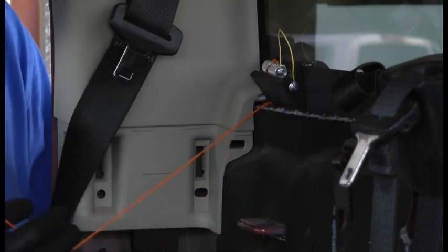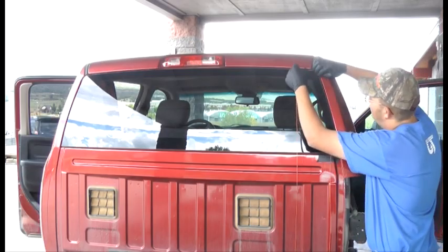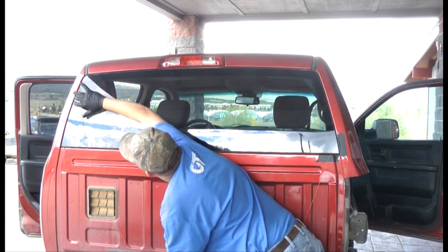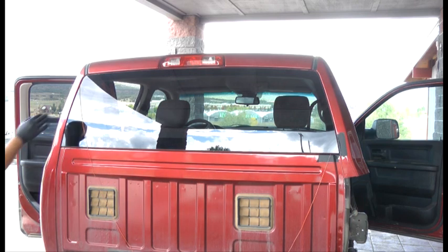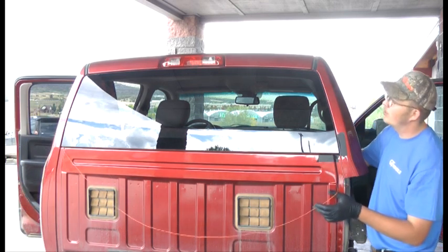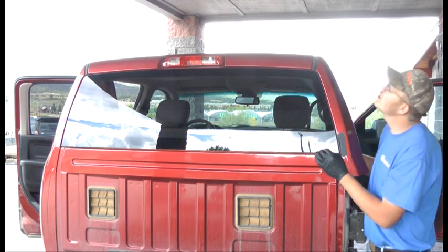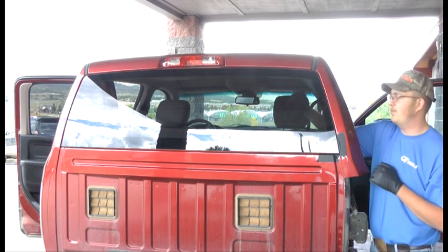We'll go around the outside of the glass and come back to the inside for the shortcut. We're gonna go up around the top first, because the glass will be your friend and hold the string where you want it. So now with this slack left, we'll pull the rest in from the inside, and it's pulling all the way around, but it's pretty easy, don't have a load on it. While you're doing this, you want to make sure your string's staying in the pinch weld everywhere, and now that it's up against the urethane all the way around, we should be good to go into mounting the shortcut.